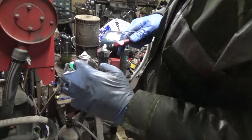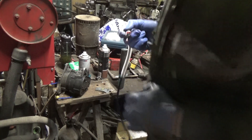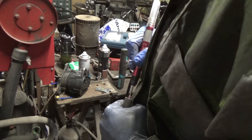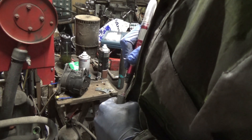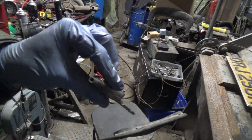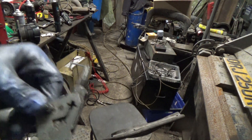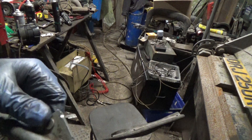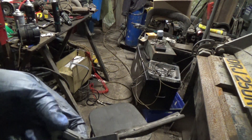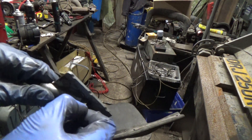What I'm going to do next is start grinding these ribs out of here — I'm just going to use this die grinder and just keep at it. So we've now got this choke cable sleeve into this diesel stop control top, and now we need to get this into our TDI ignition switch. I milled that off, tighten that screw up — that's in there nice and tight, and the outer cable will go into there as it would have done on the diesel system.